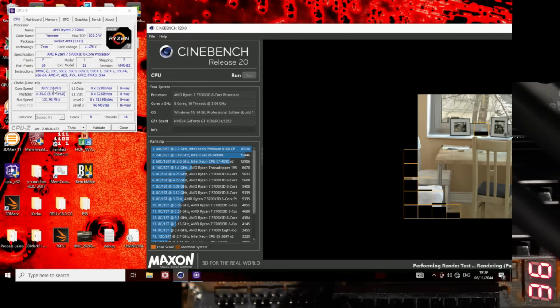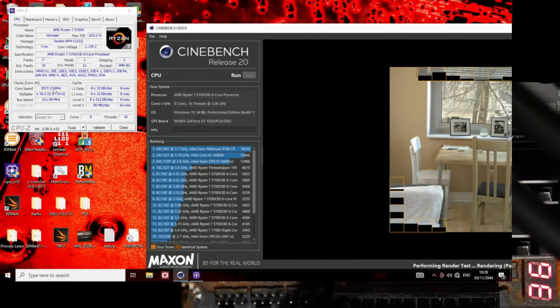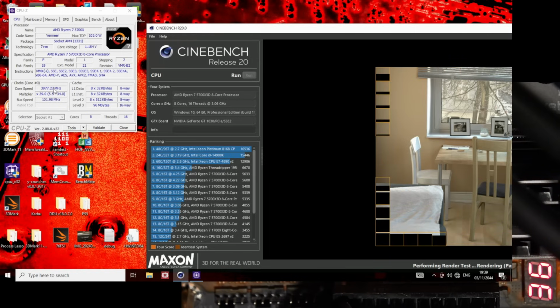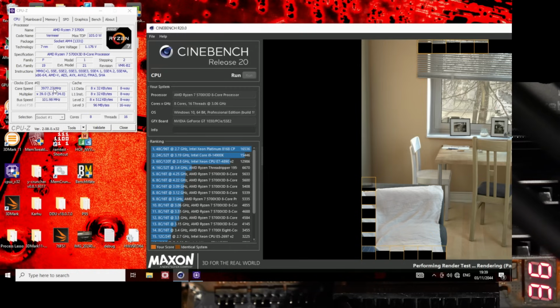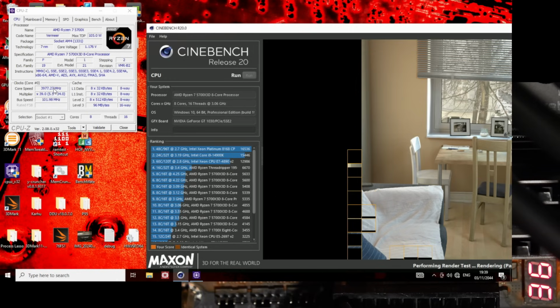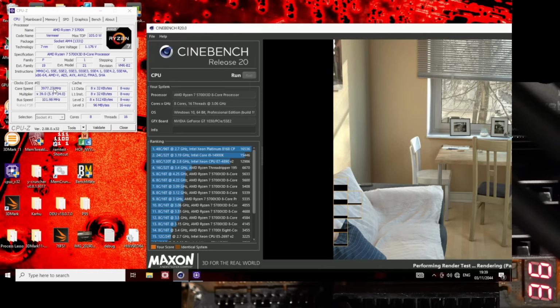See, this is the thing that frustrates me to no end when I hear from people about how they have some massive undervolt and their frequencies are so high. But the frequency doesn't mean anything. It literally doesn't mean anything on modern CPUs, and also some modern GPUs as well. I'm not sure about AMD GPUs, but NVIDIA GPUs will quite happily report core clocks that are not reflected by performance whatsoever. And AMD CPUs are capable of the same thing.